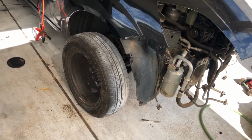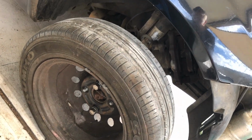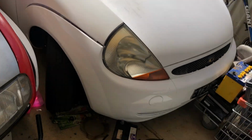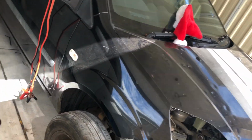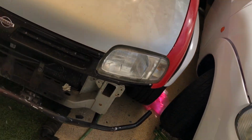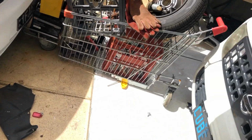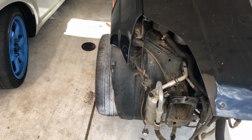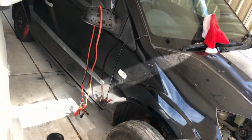So as you can see, I managed to get the wheel on. I have mounted it backwards just for a bit of clearance, otherwise everything's going to scrub back there. I was going to take the brakes with the KA because it would be a beefy upgrade, and it's really what I'm looking for. Unfortunately, that means we'd have to run bigger wheels because the KA runs on 13s. Only other issue with that is the bigger the wheel we go, the less tyre we have, and I kind of want a lot of tyre because this won't be seeing a lot of tarmac. But oh well, so this is the fitment on it. I'm not really too fussed, it's safe enough to be rolled and that's all we're going to do, so let's do that now.